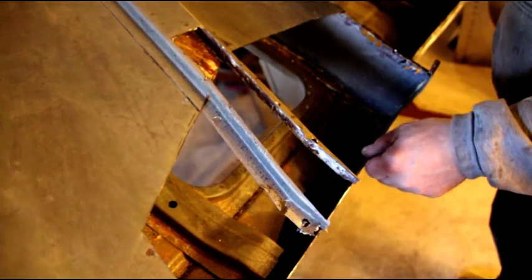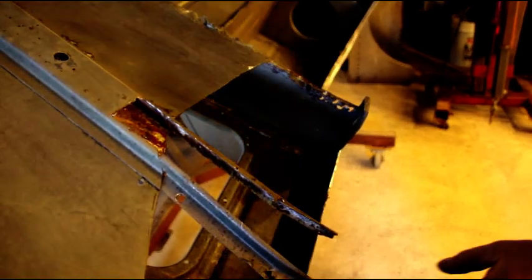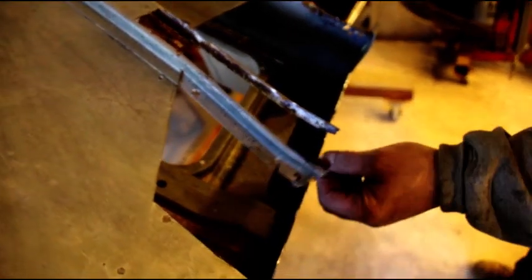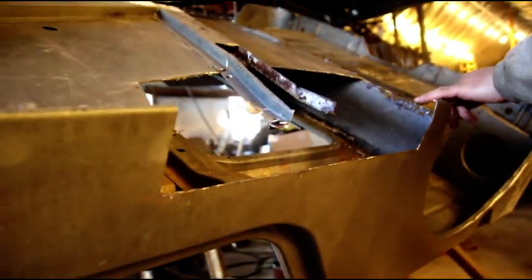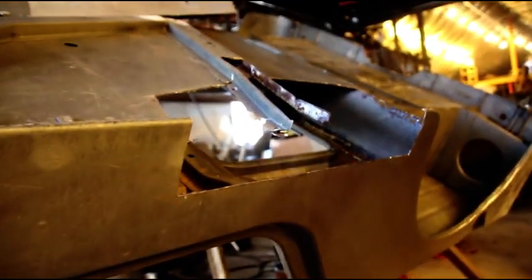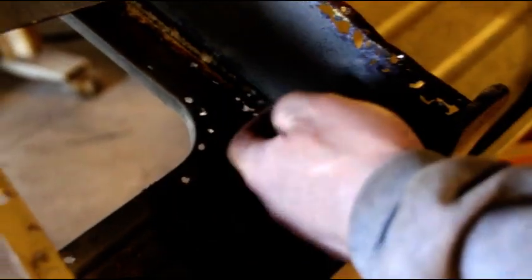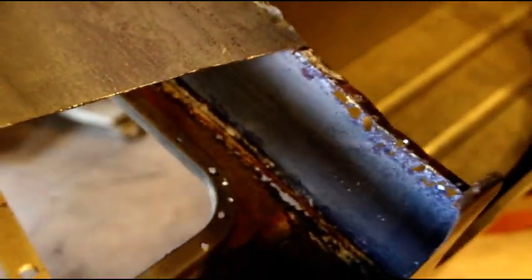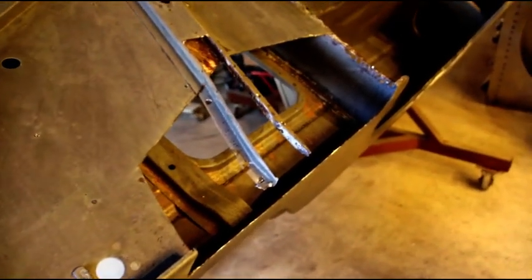I like to cut my patch panels out with the die grinder — I'm not one of those plasma cutter guys that just hacks everything out. Just be as careful as you can. We've got a nice straight line so it'll make our patches go in easier. We've got to take care of the rust here and put pieces in until it's nice and solid. I didn't realize this was as bad as it is. We'll cut this out, keep chasing the bad parts, put new stuff in, and make it right.